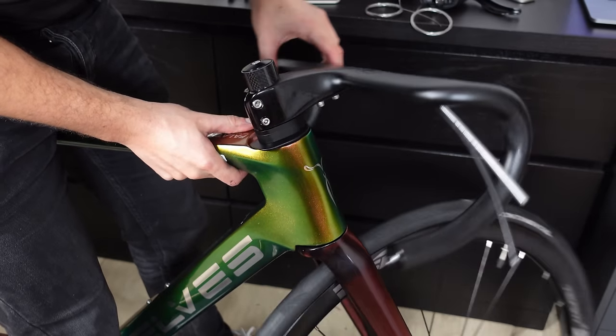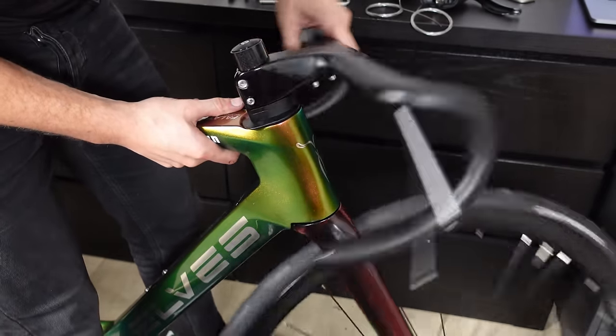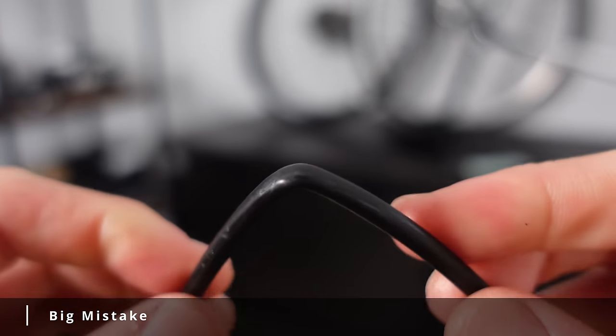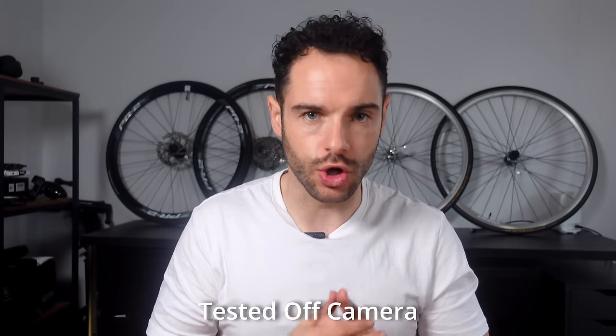Check if there is any play in the headset, check for rattles in the frame, check the bars' side-to-side motion. The biggest issue with routed housings is pinching or creating a kink in the housing — think about your garden hose: when you create a big bend, you get no water. To test it, I got a spare gear cable and tried each housing. Both gears were fine. The rear brake had some resistance. The front brake was very tight and the inner cable couldn't get through.